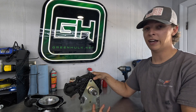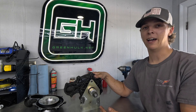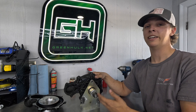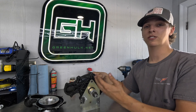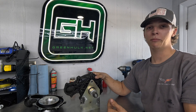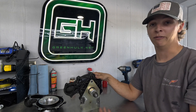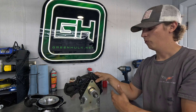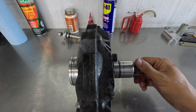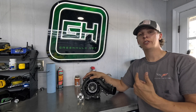Your supercharger might be completely fine but the slip is low — all you have to do is reset it. I've also heard some shops say as little as nine pounds of slip is perfectly normal, which is also not the case. If you only have nine pounds of slip, you're not going to be making near the amount of boost pressure that you should and your performance is going to suffer. On a bone stock ski, maybe with a tune, I'll set the slip to 14 pounds. If you modify these superchargers to make more boost, the slip number has to go up. Don't let anyone tell you that your slip is low so you need a completely new supercharger — you just need to reset it. I can do that for you, link will be in the description.